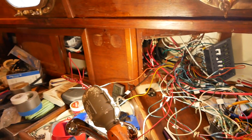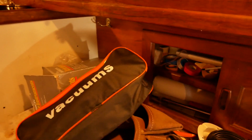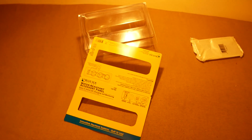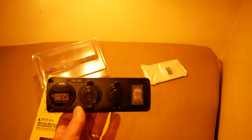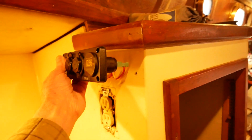Still working on this massive rewiring project. One thing I want to add to the DC circuit panels is a 12-volt line for recharging and running things like this vacuum cleaner, which has a standard 12-volt-style plug, and USB devices. I'm going to use this platform to hold devices that need charging, and I'll install this Blue Sea Systems panel, which also gives me a voltage readout to monitor whether I still have 12 volts.